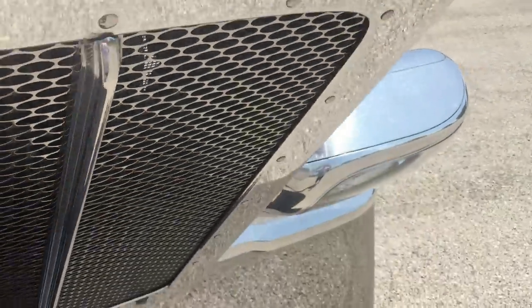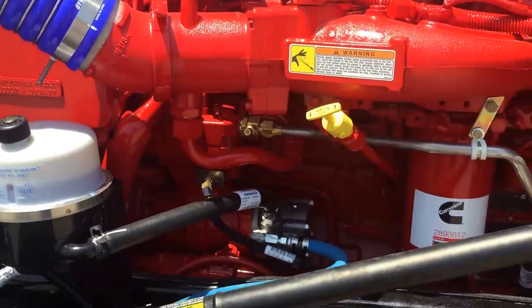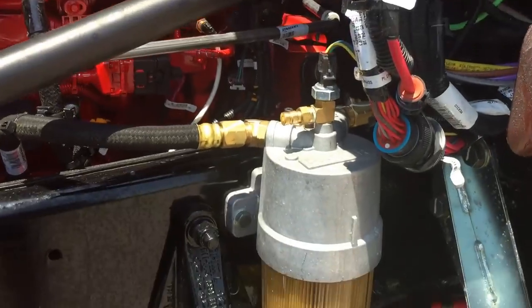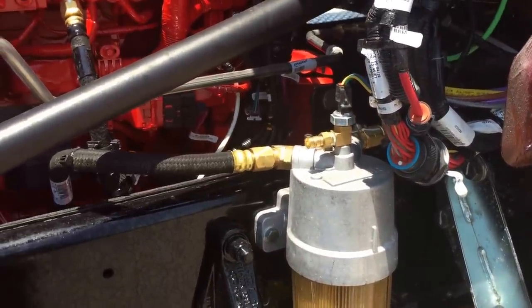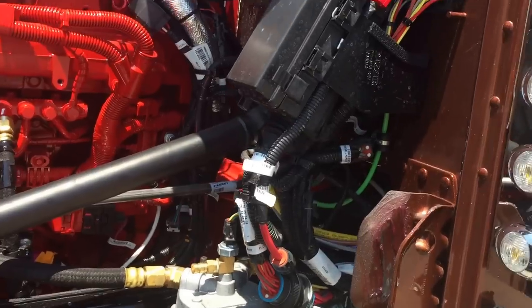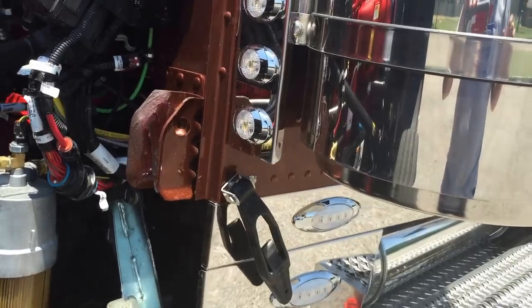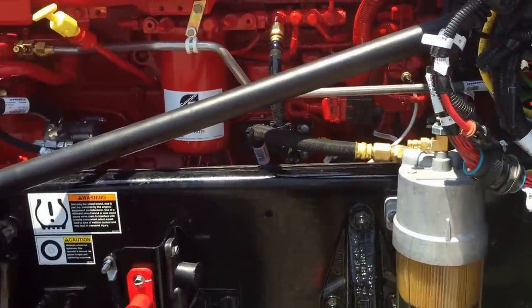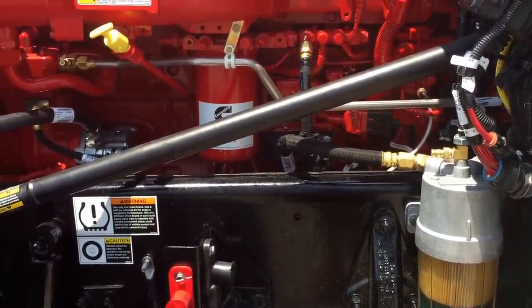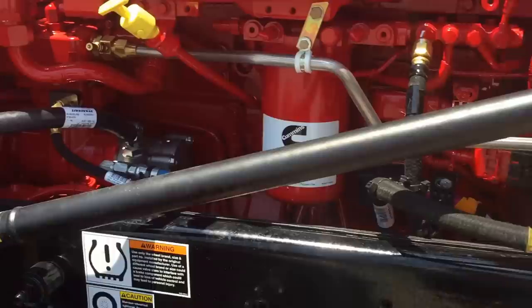Let's crack the hood back real quick. 550 horsepower in this Cummins ISX 15, 1850 torque. Heated fuel filter. All of the fuel lines on this truck have the arctic wrap. And for protection, I put the best insulation package I could in the cab and the sleeper — that's the floor, the walls, the ceilings, the doors. It does great in the winter to keep it warm, but on a day like today when it's 100, 105 and the air conditioner's running, it helps keep it cool. That little bit of money is worth every penny.